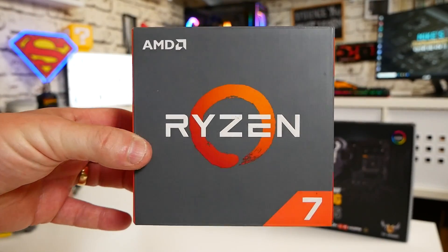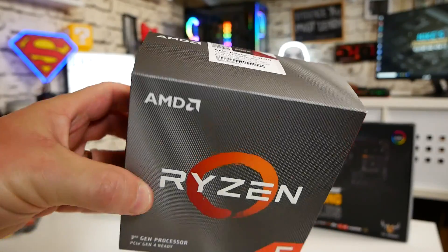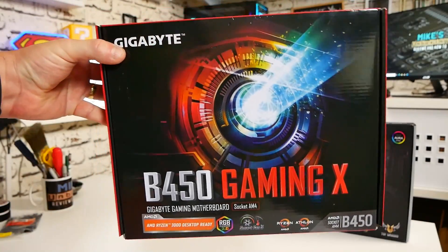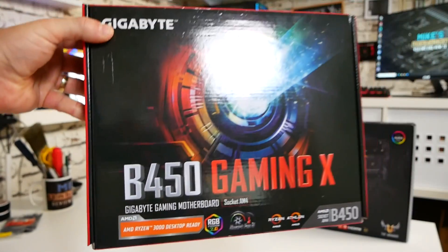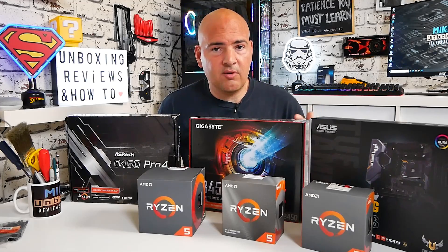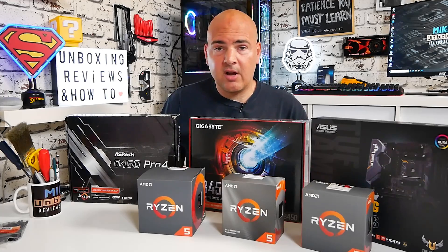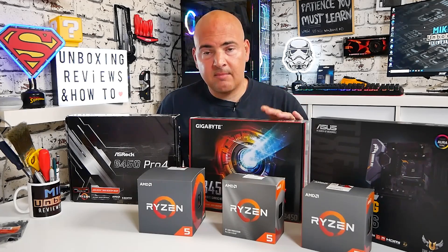Moving up further, there are more premium B450 boards. If you're using Ryzen 7s or a Ryzen 5 3600, boards like the Gigabyte B450 Gaming X, the Tomahawk, Tomahawk Max, and the MSI Pro Carbon are fantastic. They give you a lot of flexibility and will take pretty much any AMD processor, giving you a very good stab at overclocking. Anything from a Ryzen 5 1600 or 2600 up to a Ryzen 5 3600, 1700X, or 3700X — these boards are going to be pretty good, though slightly limited towards the very top end for RAM frequencies.